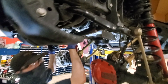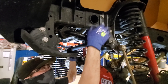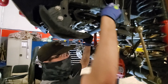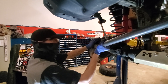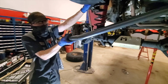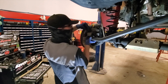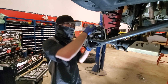Throwing in the drag link now. We're starting with the top first — it just makes it easier. This drag link is capable of being set up in a high-steer position by drilling through your knuckle, but we're not doing that today — just replacing it in factory configuration. It's left-thread, so note that on installation. Torque specs on the nuts are 55 foot-pounds, and for the actual adjusting clamp bolts it's 90 foot-pounds.